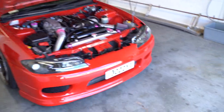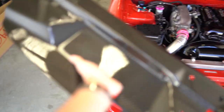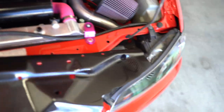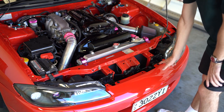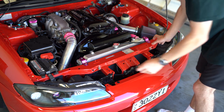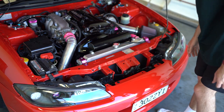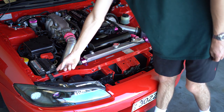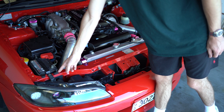Here we are — the carbon piece. You can see when you're looking at the engine bay there's just this big open gap at the front which really doesn't look great, so that's the point of this cooling panel. It goes right in here and pretty much covers up that whole section, and apparently it's supposed to provide better airflow to the radiator, but that's not why I bought it. It's super simple — just need to take these little front bumper clips off which will clip over the carbon, and these radiator supports will sit on top. I've also got a bonnet sensor here for the alarm system, so I'll take that off and see if I can fit it on the cooling panel, otherwise I'll have to relocate it.